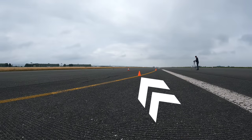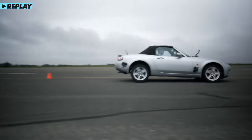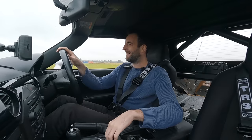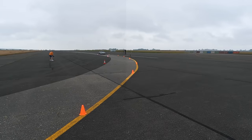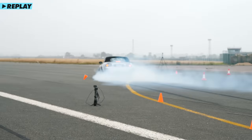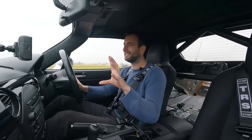Let's put that to the test in our curve braking test. I'm going to get on the brakes at this cone and try to make it around the corner. With ABS it's just amazing — you can still turn. It isn't slowing down as quickly as it would in a straight line because it needs to turn as well, but it's doing exactly what I'm asking it to do. Now without ABS, what's really hard is not to counter-steer or put any opposite lock in because that is my natural reaction. And as you can see, I just went absolutely straight on. You can really see how ABS helps turn a car, but when the tires are locked up, the car just goes straight on.